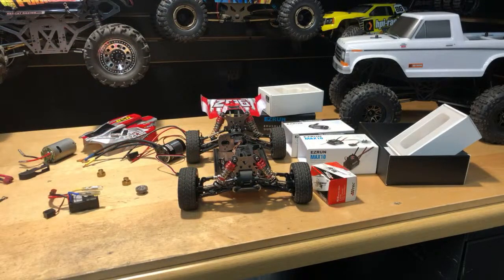It's like over 18 turn or 24 turn, you can do it on 4S if I'm not mistaken. I think it's around 24 turn. 24 turn brush motors, dual, you can run on 4S. Anything lower than that, you need to do it on 3S only. But I'm pretty certain of that one. That's how that kind of setup works. Let me see if I missed anybody.